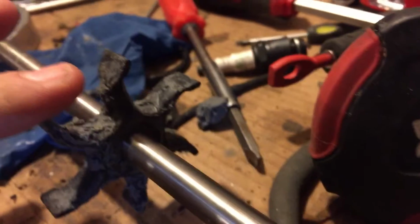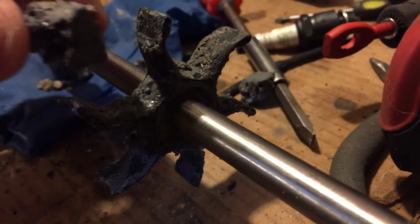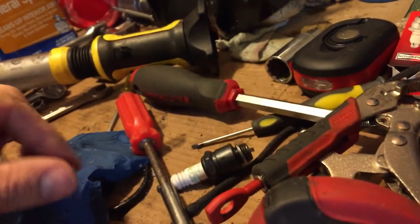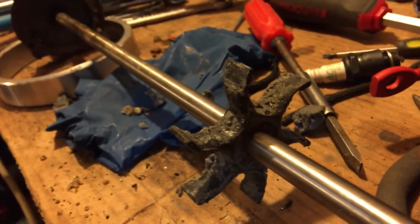Okay, so it wasn't pumping water. I'm assuming the water pump was really damaged. Check this out. 1950. This impeller's impeccable. There's nothing wrong with this thing. It was gunked up. All of this grease had just kind of stuck there. So I'm assuming the shaft just spun without it moving, and even if it was moving, the grease was blocking any water flow.